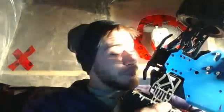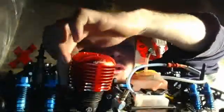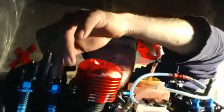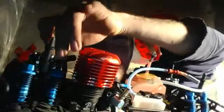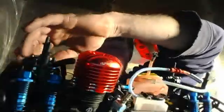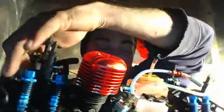I find that my truck goes really straight with the stock motor, and it flies. So what I have to do also for my exhaust is, my exhaust comes out of the rear, right here. So I have to remove this shock and actually remove the two front shocks, because it's a dual shock setup. I'll remove the two fronts on the rear, and I'll replace the two rear secondaries with 1/8 scale shocks. So it'll be a little bit beefier to take the weight of the engine, and that's pretty much about it.